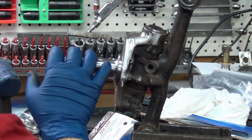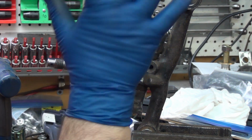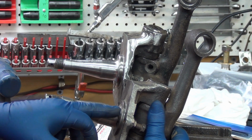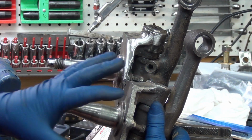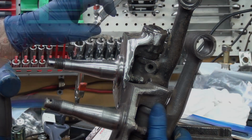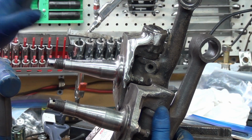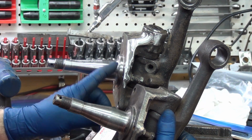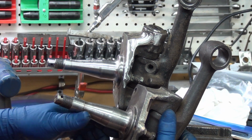I'm going to do a quick look here now with the 620 spindle. I've shown this plenty of times before, but a lot of new people. The boss here, this is a 521, so this is 320 through 521. This is 620. Now there's a couple ways to readily recognize. If you can't see this boss here, see this boss is taller, that makes it a 620.